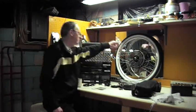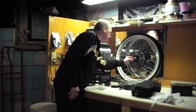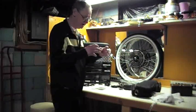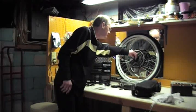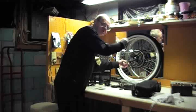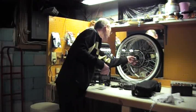One of the things I've noticed is that the axle on this actually has a flat spot, so it will fit down onto the forks — because the axle is the only stationary part. This whole wheel turns around the axle. So if you didn't have that flat spot and you turned the power on, the axle would start to spin. It's quite an ingenious system that they have.